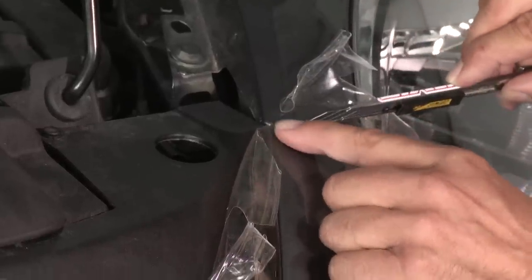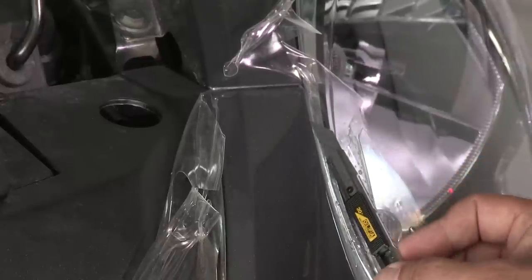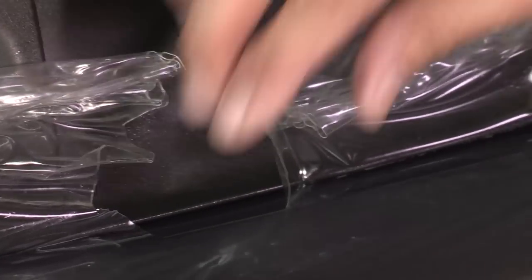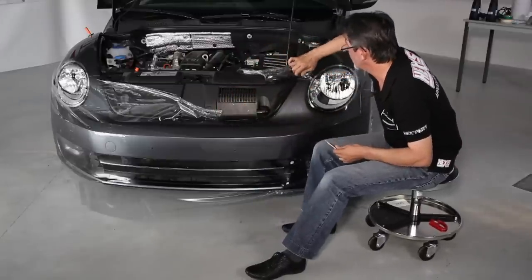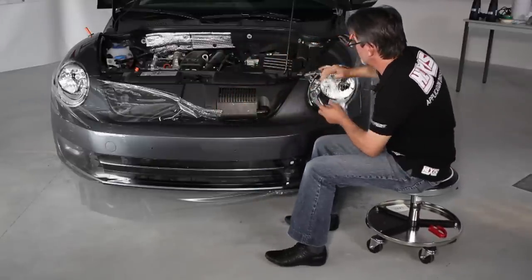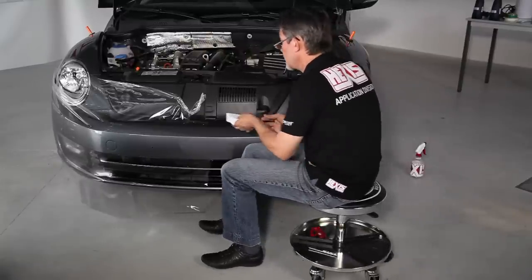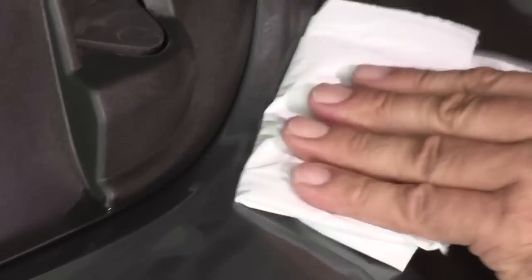Each corner must be cut with a round cut. The product will cut itself when you pull sharply in the opposite direction — it will cut itself neatly. To finalize the cut, we use a piece of tissue paper wrapped around the squeegee to dry the edges. This way we can take away any remaining humidity and thus ensure good adhesion.